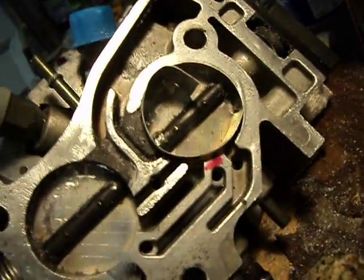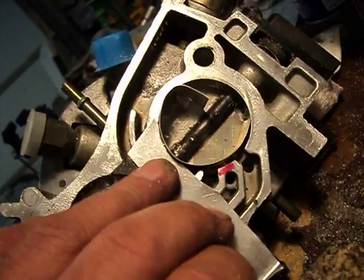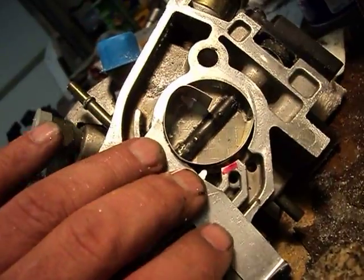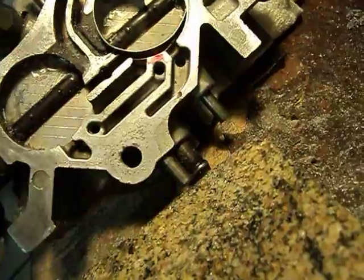Then, in order to keep it in the right shape and keep it from falling out, I made this cutout and I just slide it up there like that, and I hold that in place until the JB Weld dried — or actually just until it started setting up. Then once it hardened enough, I used the stuff that was on my mixing board to check whether it was tight enough, and when it was, I just gave this little thing a yank and pulled it off.